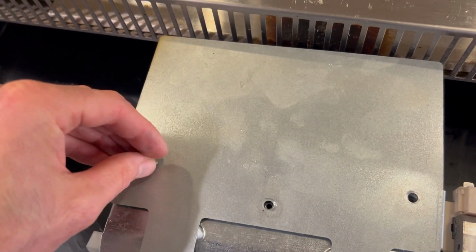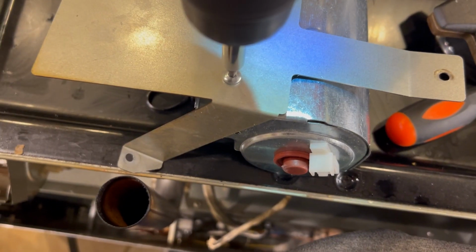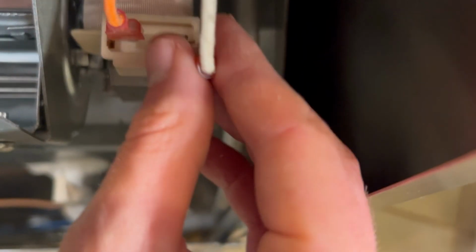The 3 holes lined up. These are self-tapping screws. You may need to push hard in the new sheet metal. Be gentle with the new wire connection, just like the old one, into this side. We will close this in the exact same way we opened it. Orange connector to the left, push that on. White to the right, plug the unit back in, re-bolt it, and test it.